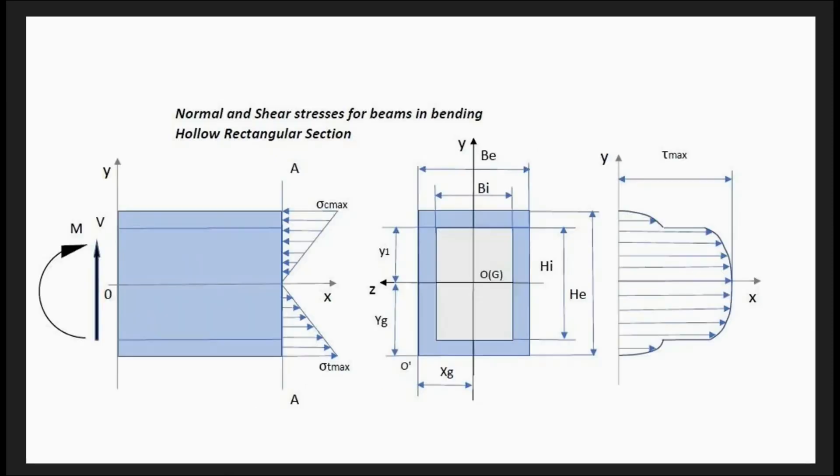When I say that externally applied forces need to be resisted by internal stress systems, what do I mean? I have here an example of a rectangular hollow section, which happens to be the same as the main chassis rails in the Land Rover and many other 4x4s. The horizontal plates at the top and bottom are called flanges, and the vertical plates at the side are called webs. Considering the applied bending moment: this is resisted by equal and opposite internal stresses acting longitudinally along the beam — compressive stresses in the top and tensile stresses in the bottom — with maximum stresses at the extreme outer fibers. By far the greatest contribution to bending moment resistance comes from the top and bottom flanges; we can almost ignore the contribution from the two webs.